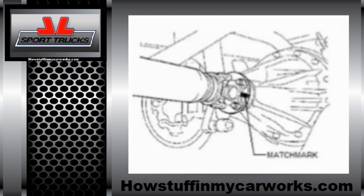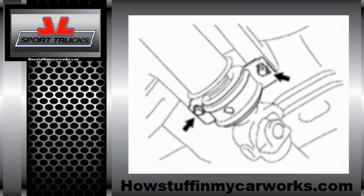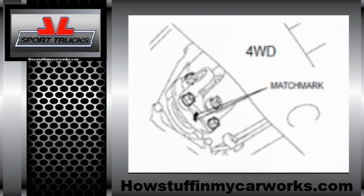Last step, remove the drive shaft by removing the last bolt and nut at the differential. Hold the driveline with one hand, followed by the 2 carrier bearing bolts, and at this point you need to hold the drive shaft so it doesn't fall. And last, remove the last bolt and nut at the transfer case, remove the drive shaft and set it aside.